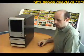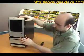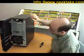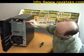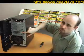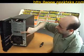With the hard drives all set in our internal drive bay, now we need to work on our external drive bay. To do that, we need to open up the case to reveal this section here. Our optical drives are going to go in the top slot and the third slot to help with cabling. And our combination 3½-inch floppy drive and multi-format card reader is going to go down here in the external 3½-inch drive bay.